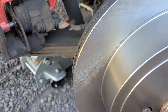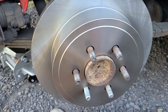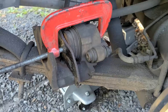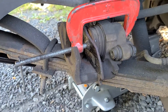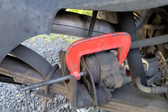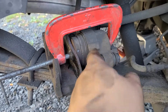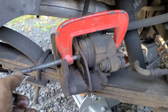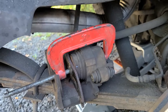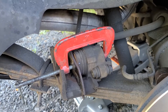Put the new rotor back on the truck, add the other brake pad, and then you've got to compress your piston. I'm just using the old — almost non-existent — brake pad to recompress the piston with a simple C-clamp. Just twist the C-clamp down and it'll compress the piston, and then you can use that to put the caliper back over.